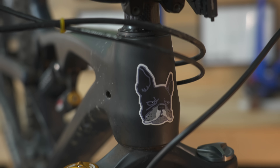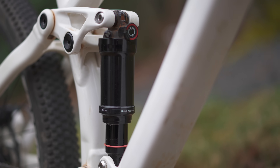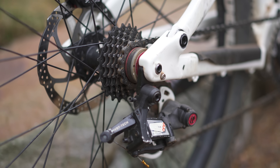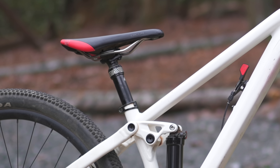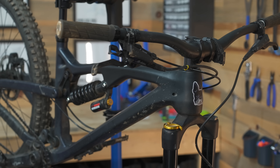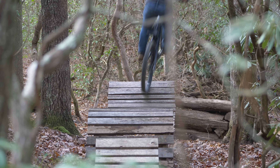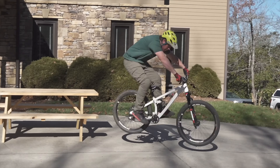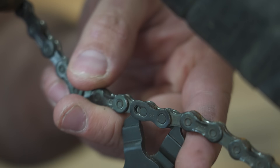Simply put, a slope duro bike is a trail bike converted into a slope style bike. Over here we have Kevin's slope style bike, which is basically a full suspension dirt jumper. It's a little bit smaller than a trail bike. It doesn't have gears — at most a few gears in the back just for changing speed. Much stiffer suspension, not made for climbing, and you can't raise the seat up. So why build one? Well, for fun, to repurpose an old bike, and we do a lot of things on Berm Peak that we could actually use a slope duro bike for. It's more reliable because there are less things to break, it performs better on jumps, and you can never have too many bikes. So let's get my old trail bike cleaned up, start taking some parts off, and I'll show you how we make this conversion.